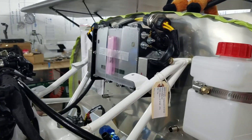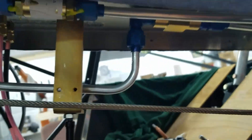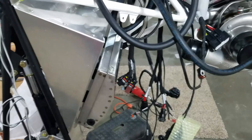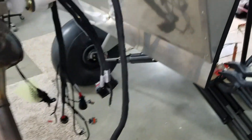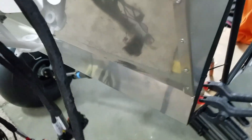Fuse box - I've finished the gas lines, got them tied down now, just need to trim them up a little bit. I went ahead and mounted the intercooler because I have a lot of electrical lines and other plumbing, and you really don't know where to put those. Here's the fuse box. About half of them go to the bottom of the fuse box here, and about the other half go to the ECM - engine control module - which sets here. You have to mount it wherever these will plug into it, and it says don't mount it until you get the wires on there and see where they'll reach to.